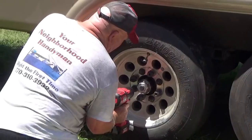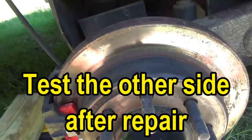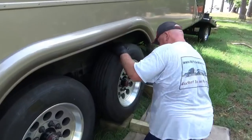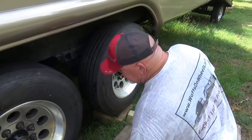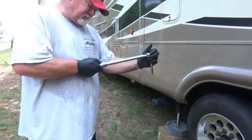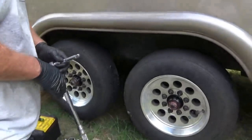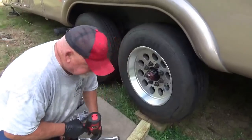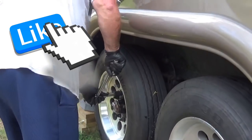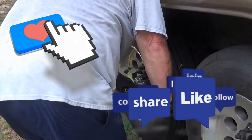Look at that — much better! Brakes released, they're running good. Was that one stuck the worst? Yeah, this one was — and that's the one you had the rotor crack on. I'm going to torque it to 115 foot-pounds. You hear people saying 150, 200, 100, 125 — but 150 is too much. When we make our first stop, I'll check them just to make sure everything's still working good.